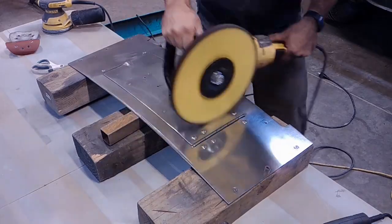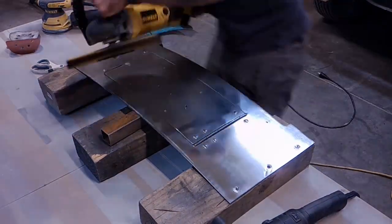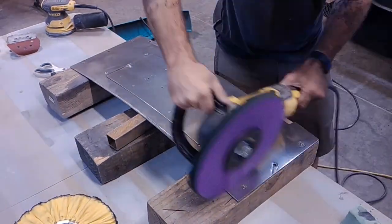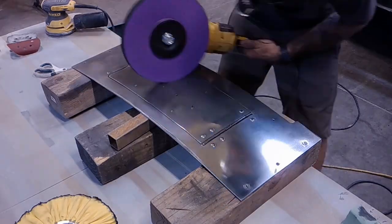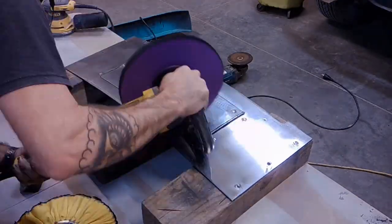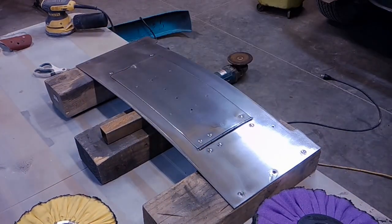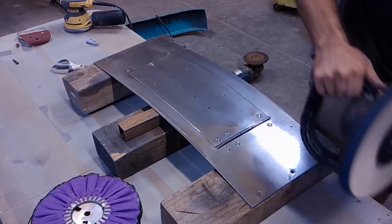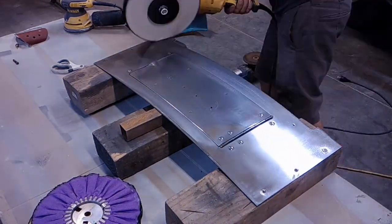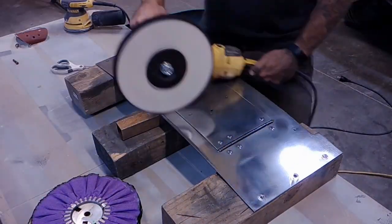And this is a difficult piece because there's some unusual angles and there's a bunch of rivets and there's hinges and stuff like that. So the flat portions on the van will be a little bit easier. But I just kind of wanted to show the whole process here of what it took. The little trial and error. So this is my medium cutting polisher. I was using the green rouge for that, and then now I'm finishing it up with the soft polisher, the white wheel with the white rouge.